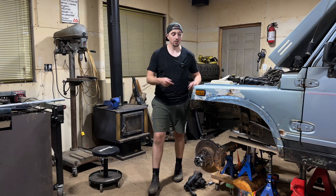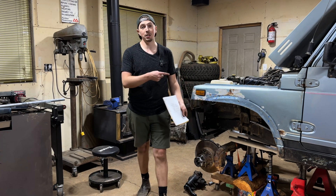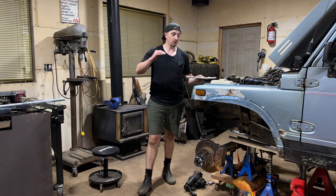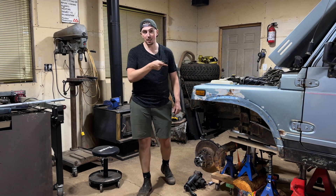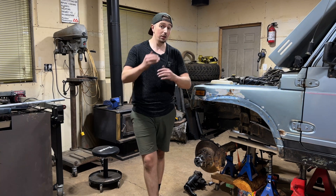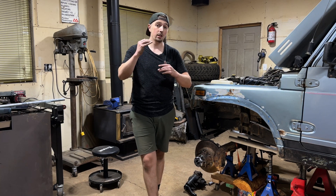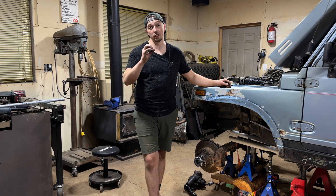We learned a lot with this. I got a whole bunch of new measurements. We had a couple of iterations of the frame side mounts. At first the lower link was colliding with the upper link mount, so I'm really glad I used this PVC because as soon as I got in there it became extremely apparent that it was going to be a problem. I was able to shift those measurements up a little bit to give us a bit more separation between the two, and things are looking really good right now.